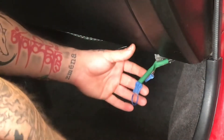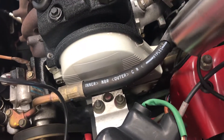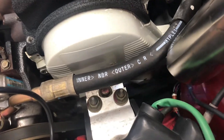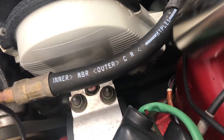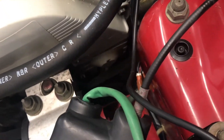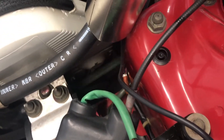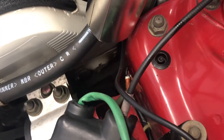Just like that. It's going to be hard to show you on camera, but we are aiming our timing light at this pointer right there — see that V? You look down straight through the V at the crankshaft pulley. There will be a line on the crank pulley, and this strobe light is going to help freeze it in time to see where those marks are.